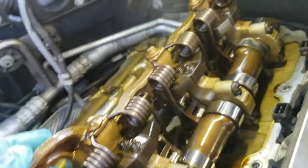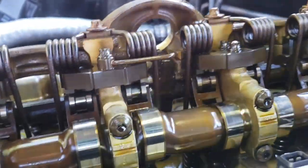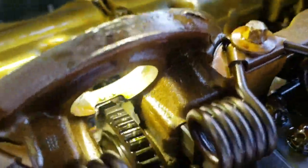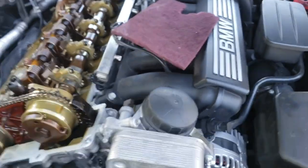intake valve lift. We can see here, this one is like a half moon style only here. I can see half tooth, and on the other side, see, only from here to here is halfway. So where the motor rotates that one to vary the intake valve lift. And I'm going to be cleaning the surface.